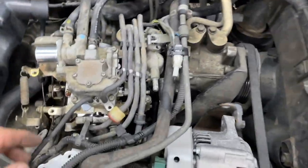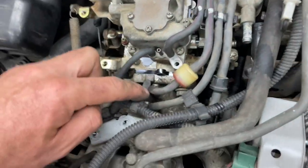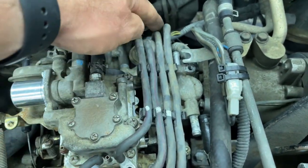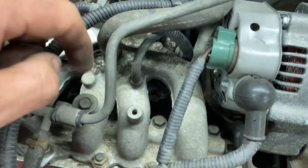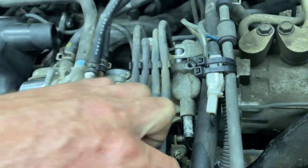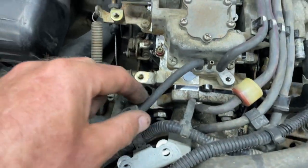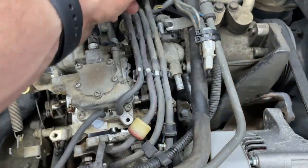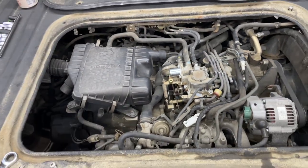But continuing to put everything back together, we got our carburetor choke running to the front nipple on the intake manifold. Then the second nipple back on the intake manifold is this line, and then our farthest one out comes with this filter, probably, or some kind of vacuum filter, goes to the farthest front nipple. And I checked and it runs underneath all the wire looms, and then that clips there. Vacuum advance, I gotta put this back together and then put the cables back on, and then put the coolant lines back to our choke. And then our intake, yeah, still moving along here.